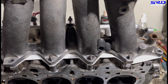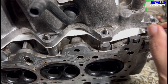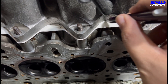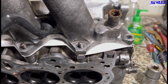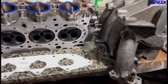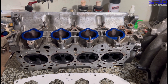Here's the intake gasket. This is how we port match it properly. We draw and scribe an outline of the intake flange onto the intake gasket. Some people say you need a dowel, but that's only if you have a two-bolt intake flange. This is a 10-bolt flange, so you barely have any movement — just vertically up and down, because it's a 10-bolt with a two-horizontal plane, not diagonal. Now let's go to the porting bench to start with the head.